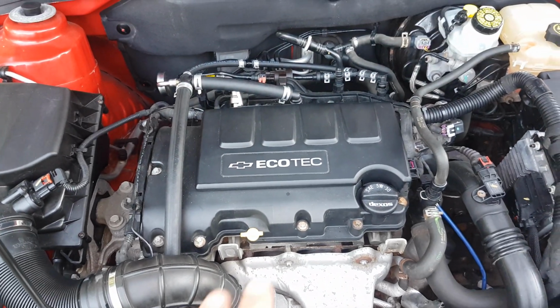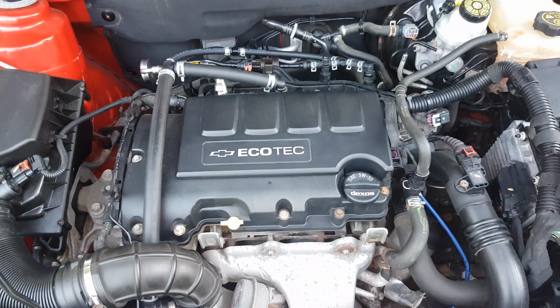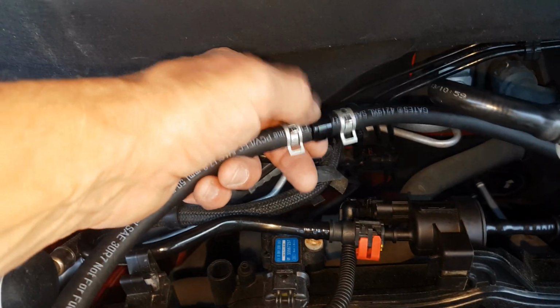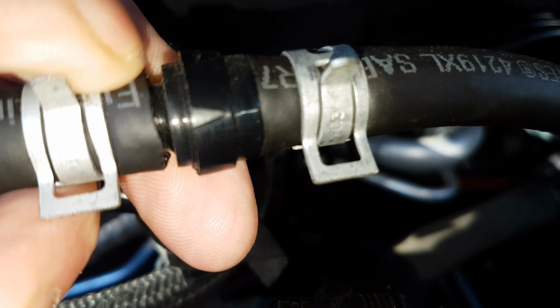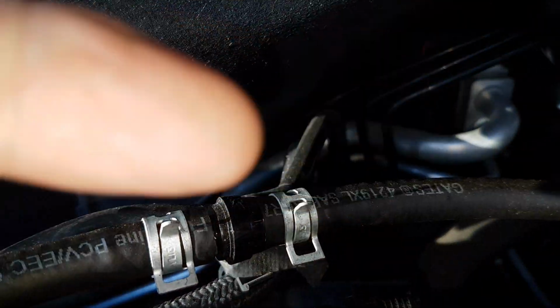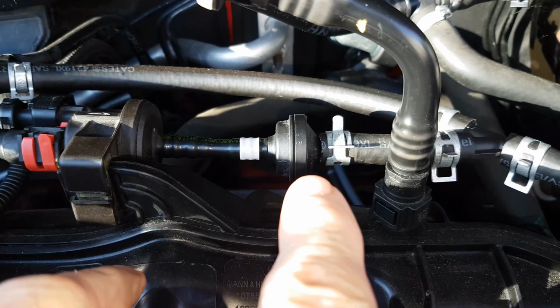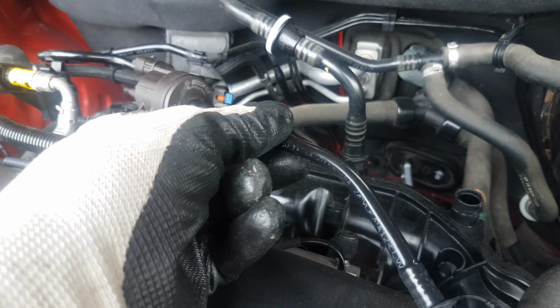Alright, I'm basically done the plumbing for the bypass of the PCV positive crankcase ventilation valve. Check valve, serviceable. Note the orientation of the arrow. It's pointing towards that direction there. Intake, evaporate purge valve right here. Supplemental information if anybody wants to know what this part number is.